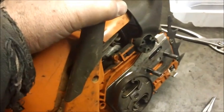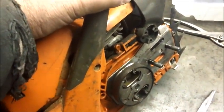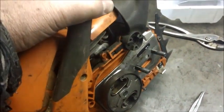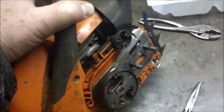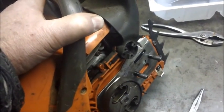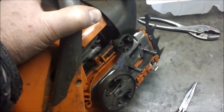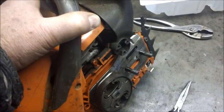This was quick. I put that little screen on the oil line — actually my OCD wife did it because she can see and I can't. Put it right back together, fired it right up, and it oils. I blew it out with air and chips came out of those lines, so it would have oiled even without the new filter. But the new little cap on that oil pickup tube should keep those particles out and keep it oiling well. Let me fire it up so you can watch the oil come out the hole.